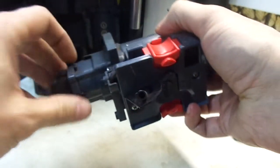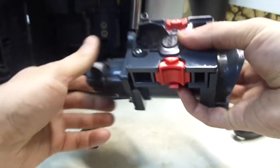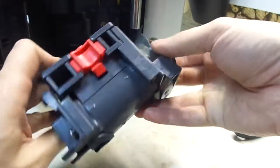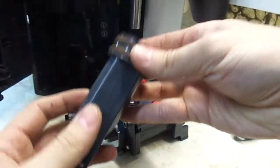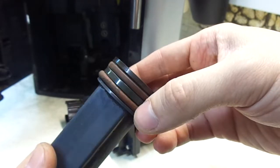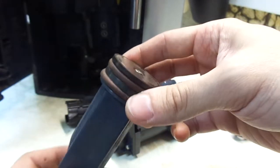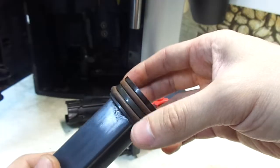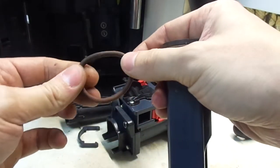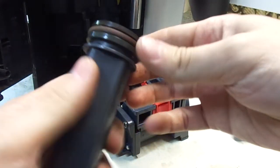To prevent this you only have to clean the brew group. We need to remove this plastic piece, then push the piston out. You can see the two O-rings — see how this O-ring expands and starts to roll. This causes very big friction and is the problem with the electronics.